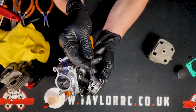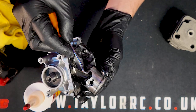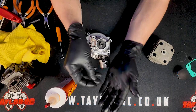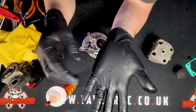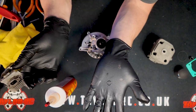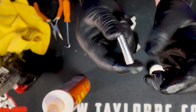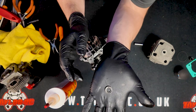I'm going to use this pry tool and be very careful with this little pick tool to get around and underneath that snap ring. I will likely damage this snap ring in removing it, which is okay because I have new snap rings to install. That actually came out really smooth — and unsurprisingly it kind of flung off into nowhere. This is why it's nice to work on a pit mat or over a towel to keep track of small parts. At this point you'll be able to push that piston pin out. Note that this piston pin is a piece that is reused from your stock setup — the new Fujiwara top end does not include it.